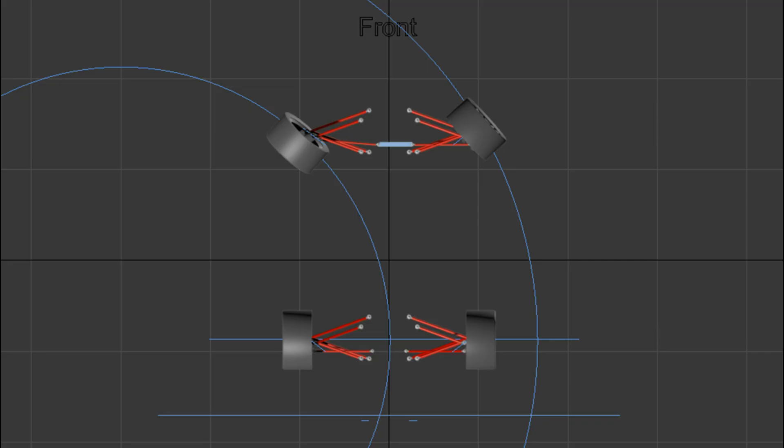To put this in terms of steering geometry, I've drawn a diagram where the blue lines represent what a perfect Ackerman steering geometry suggests your tires should be pointing in — the direction they should point if there were no slip, so they are tangent to the blue circles. The yellow lines show the tire directions after considering slip angles: the outside tires are at a greater slip angle and the inside tires are at a lesser slip angle. Looking at the direction both tires are pointing, you can see they're now pointing more or less in the same direction — parallel to each other — which is called parallel steering, meaning both tires turn by the same amount. This helps put your outside tires at a greater slip angle than your inside tires.